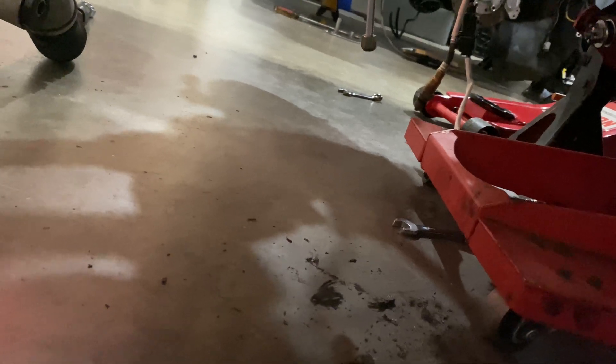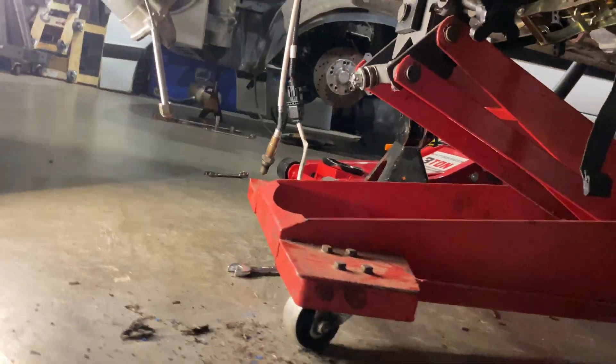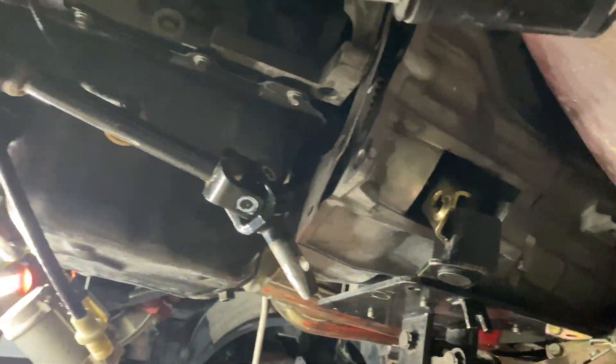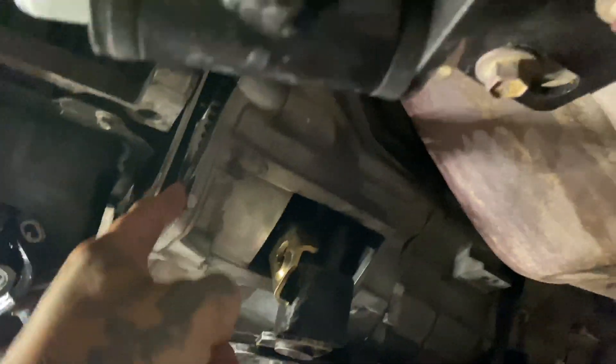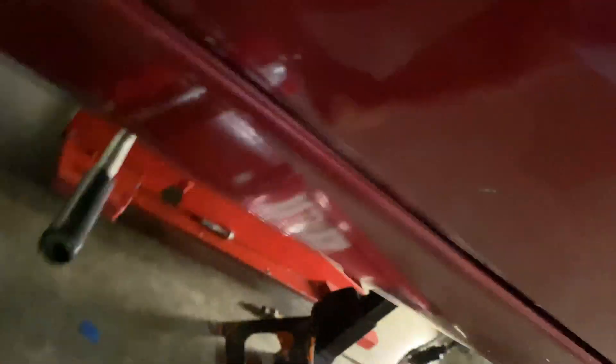Here's pieces of the clutch right here. The clutch is like a stage one — rated for right around 450 horsepower, and the car makes 430. I don't like to go based off that because I've seen stock clutches that hold up pretty well. But this clutch is made for like a New Edge or a Mach 1. It's got like 900 miles on it. I don't really think it helps that it's revving up to almost 8,000 RPMs — 7,800 is where we're shifting it. Obviously it's probably not making all that power up there, but this clutch was not designed for that.